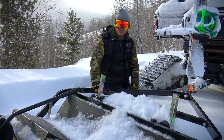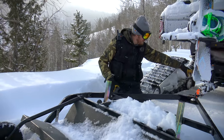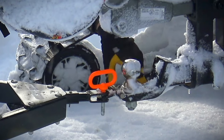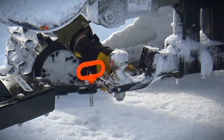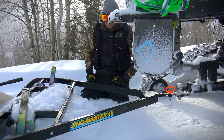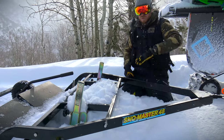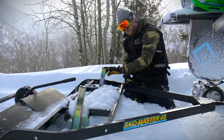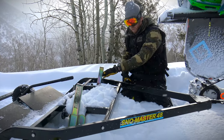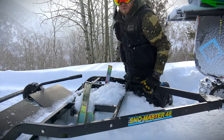So you want this as level as possible. For example, with the UTV we have just a standard hitch extension — this is like 17 or 18 inches — and then we just have a little bit of a drop, a couple inches, to be able to get a nice level draw bar. This has a snow razor blade on it, and that's the other reason you want it to be as level as possible. If you're too high, the razor won't work and you have to drop it down too low, which puts too much pressure on your snow razor as you groom. You want it to land when it's down in the snow somewhere in between there when it's cut.